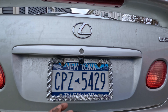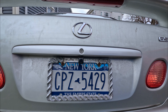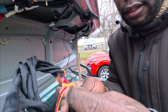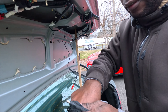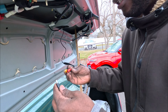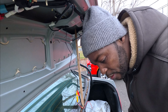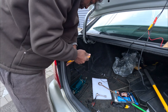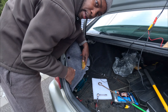I finally got it installed! I can adjust the camera this way or that way — I left a little room but it's back in place and looks beautiful. Now I need to open it up and do the cabling. This is the part that came with the camera, but I made my own longer cable because the original wasn't long enough to reach the backup connection. Let's plug this in here, and this other one in here. I need to take the light out to get to where the backup wire is — pop this clip off, pull this back, and the cable link is right here.